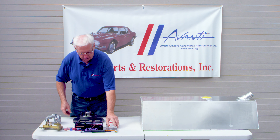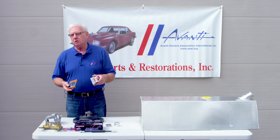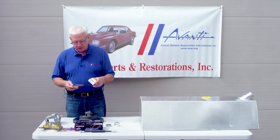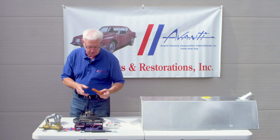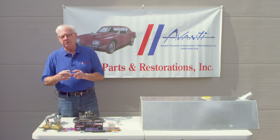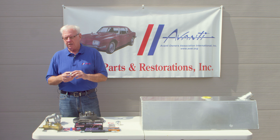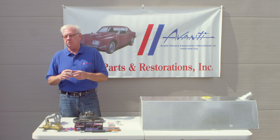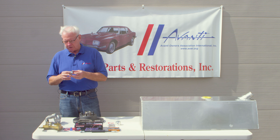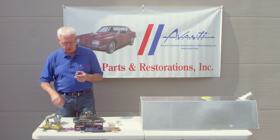The reason we're using Ford rotors is because the bolt pattern then remains the same as on the Studebaker. All the kits come with the needed inner and outer bearings. You can use the old bearings — they're still the same — but the kit comes with new bearings, so you might as well use them. The kit also includes grease seal dust covers. One important item is the seal adapter, which provides a new seal surface for the grease seal and also spaces the rotor out about an eighth of an inch to center it in the caliper when mounted on the car.